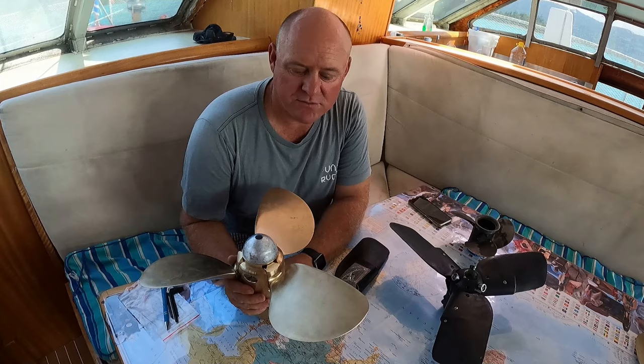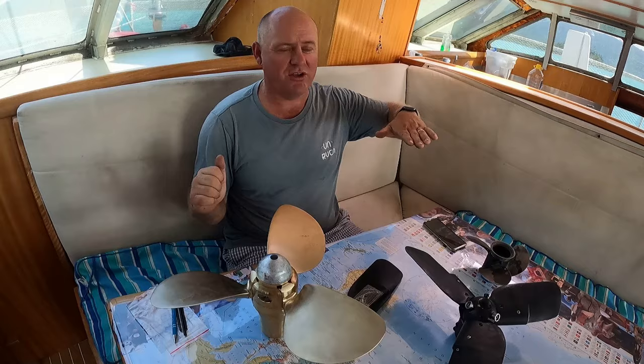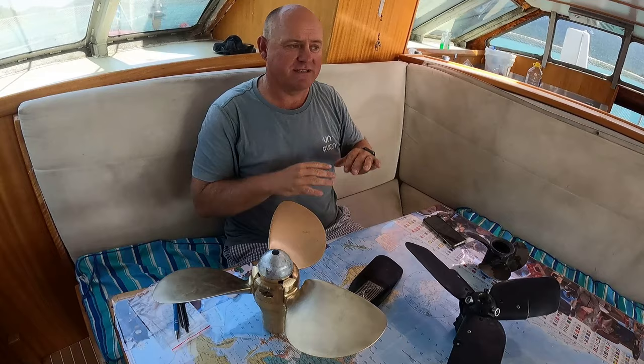Generally speaking, on high speed boats, you have counter rotating propellers, and that was my plan, to go with counter rotating. The reason being is depending on how the boat's designed, but most of the time you want to get the stern up and the bow down to go nice and fast. So therefore you have them rotating outboard where they're getting the cleaner, clearer water. The water will run faster in between the hulls, so therefore have less resistance. And on the downward stroke is when it meets the most resistance, lifts up the bum and gets you going along.